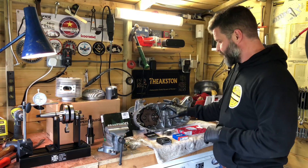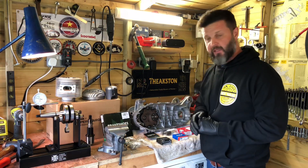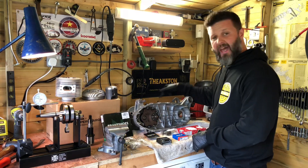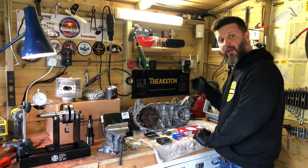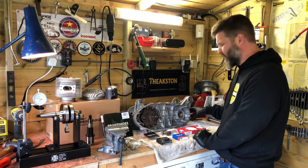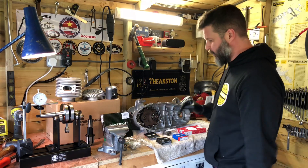Some of the stuff that came in the box was missing, so we just had to replace it. Other stuff wasn't original to the build — it had an aftermarket crank which still had the old Li taper, which I didn't like. I didn't like the crank itself, let alone the fact it had the Li taper on. And he had an Indian barrel with a mismatched piston and a few other bits that I didn't like.